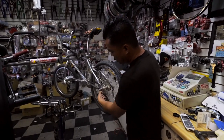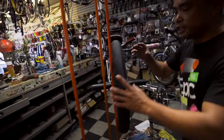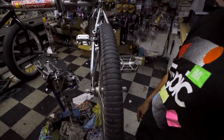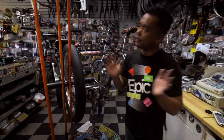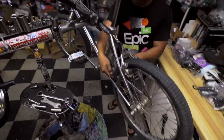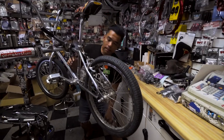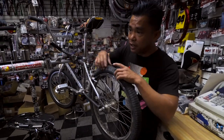The new wheel won't go on the old frame unless you mutilate the frame — sacrilegious move, guys. Do not grind this out; it will devalue the frame. Next, look at the tire sizes — old school is a 1.95-inch, this new one is a 2.4-inch. Some old school guys come in wanting the latest and greatest new tire. You can't do that — look at the clearance. The dropout gap on the old frame is much smaller. A 2.4 won't fit, and you can't put a skinnier tire on the new one.